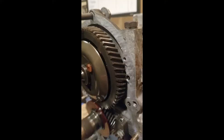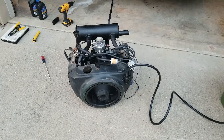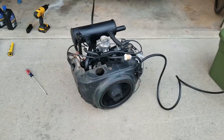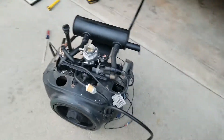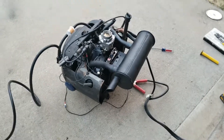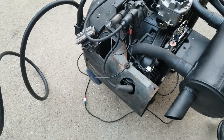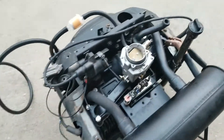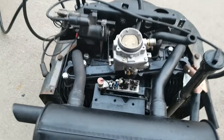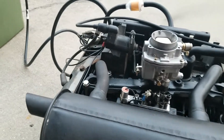You'll see those in other photos later on. It's a good unit and it's got a lot of components that are pretty unused and didn't have a lot of wear and tear. We've got oil in it as well, so we're not doing anything too risky. We have one new spark plug wire and one older one — those are fine, but that's one of the only components I left unrefurbished besides the plating. I had the points gap uncovered because I was doing some mild adjustments while it was running to see how smooth it would be if other things were changed.